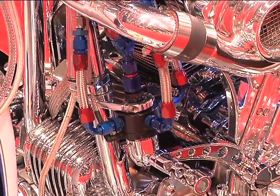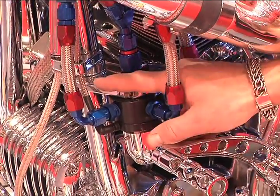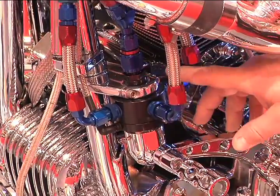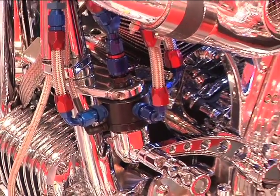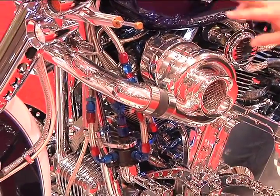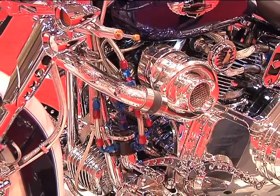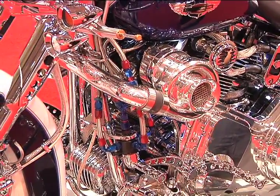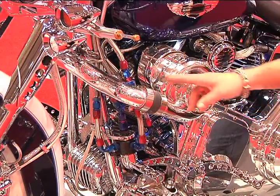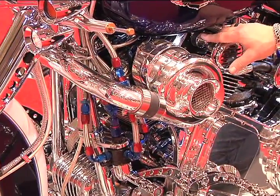What we did for this particular build: the pump that came with the bike was not flowing enough to meet the requirements for our modifications. If you have a Pro Charger and you're starving for fuel, you may want to consider making an FMU — a fuel management unit. We bought a Mallory fuel regulator with a boost vacuum hose hooked up to the regulator, plumbed right into the crossover that Harley has on the tank without modifying anything on the tank. The 100 psi pump is regulated down to 65 psi at normal operating conditions, and then as soon as it feels boost, pound for pound it'll close off the crossover and force more fuel to the Magneti Marelli injectors.